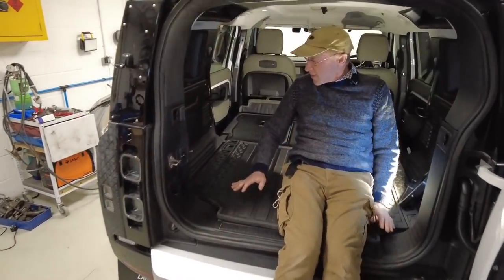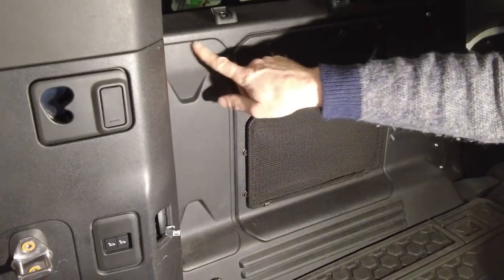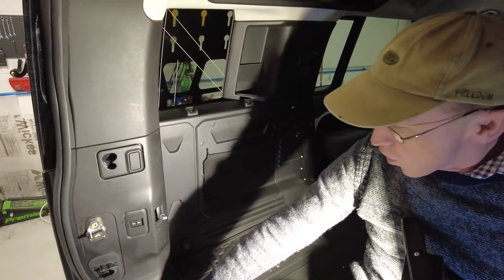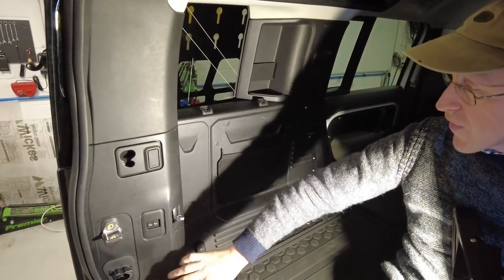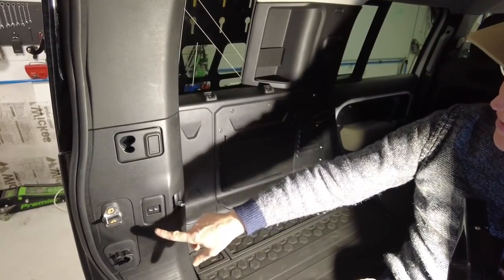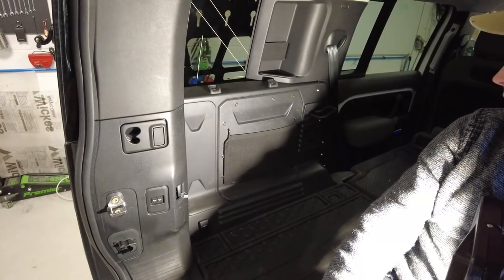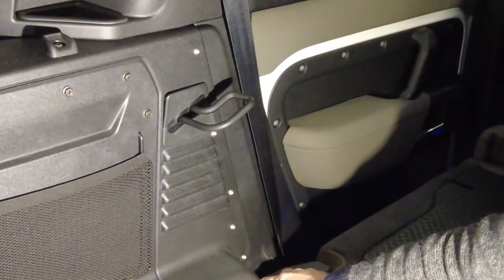It's going to live here. This little cut-out — unfortunately it's not as easy as just getting a multi-cutting tool and cutting it out. We have to take this whole panel off. We've done a video for that and I will put the link there. This panel you've got to take all off — it goes all the way down here. You've got to unplug this, disconnect that, and there's a hidden screw behind here. When we did it we actually split the panel because the two panels were joined here with plastic rivets.